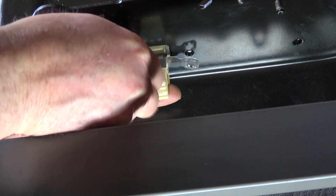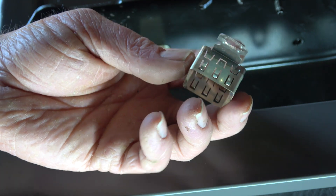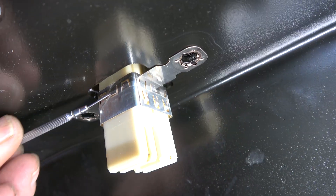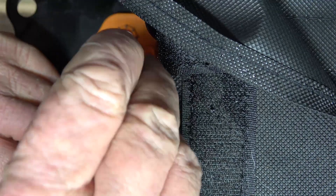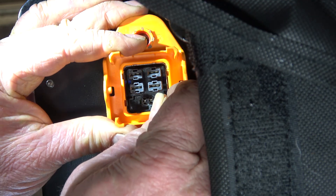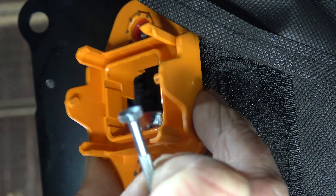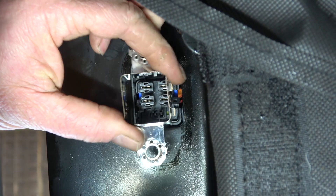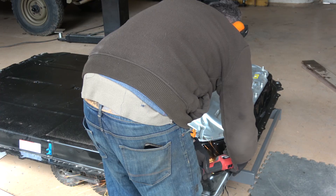To release the outer portion of the high voltage output, there are six little spring clips that need to be pushed in to release them. Then the spring clip assembly needs to be released from the inner post by bending back the little spring clips — it's all a little bit fiddly. You need to sort of pull down as you're releasing them, so just be patient and try not to break anything. The outer portion for the HVAC system just has four little tabs that need to be released, then a clip on each side of the tab bracket.